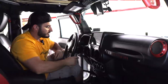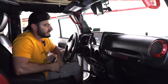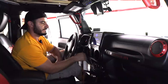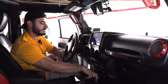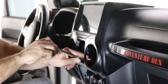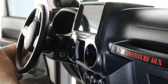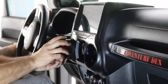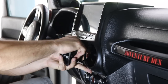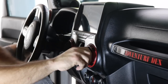Pro tip: before we go any further, I'm just going to turn on the ignition to make sure all of the connections are working and that the backup camera is working as well. It just booted up — that's a good sign. Backup camera works as well. Now the last thing we can do is reassemble our dash: put back in the 7mm bolt behind the window switches, put one of the vents back in, put the window switches back in, and then put the last vent in.